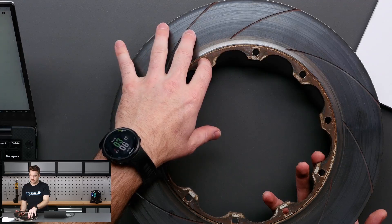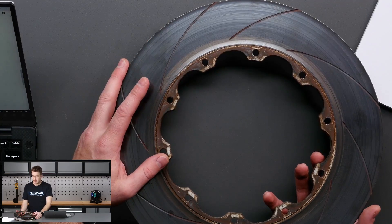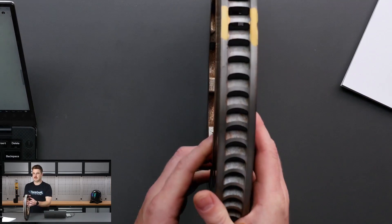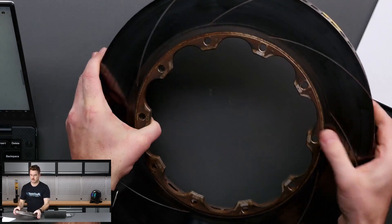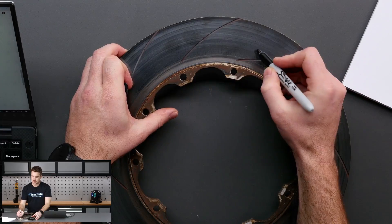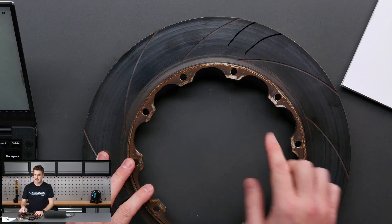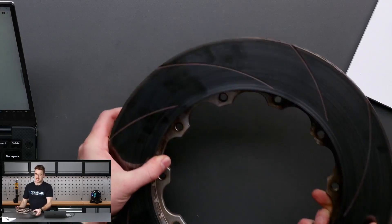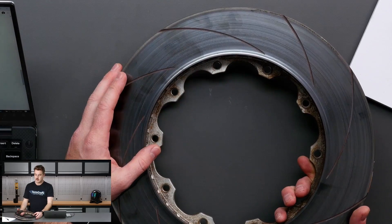The point I really wanted to make about Nick's question is if you look down through the vanes, you can see the disc is hollow. The vanes are designed to work like an air pump — we want to feed air into the inside of the disc. When you're doing your brake cooling, you always want to feed the air to the inside face of the disc and exhaust it out the edge. The way these vanes are curved is what makes that air pumping action work.